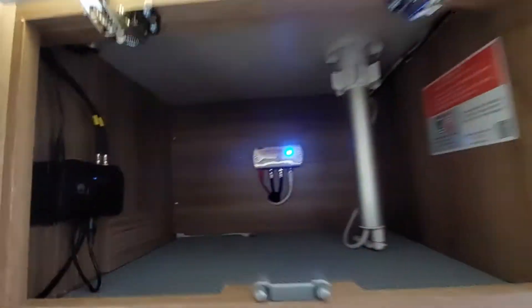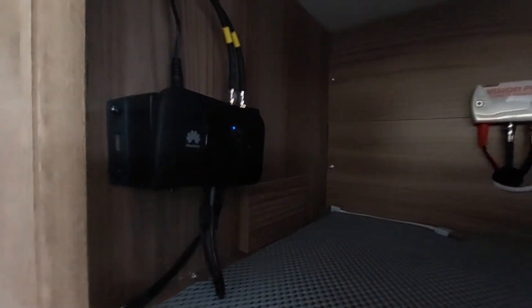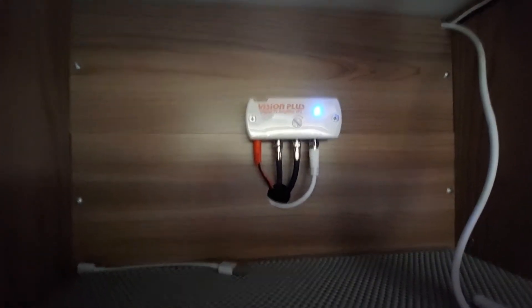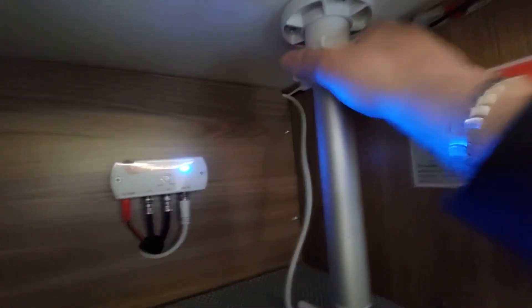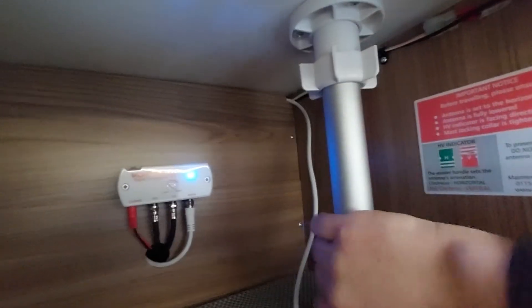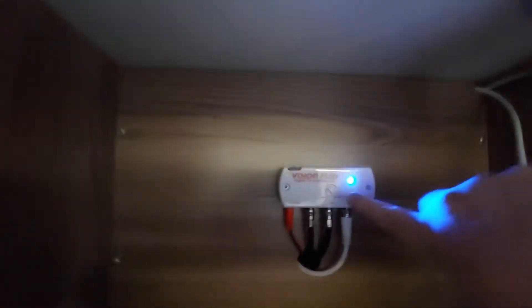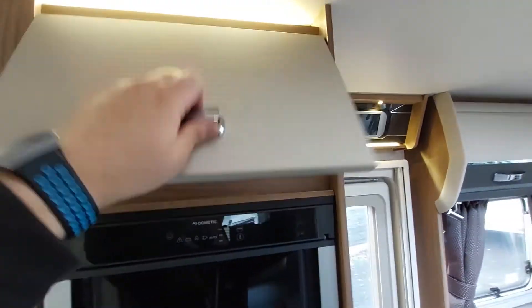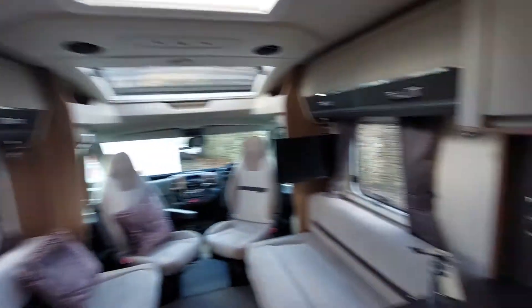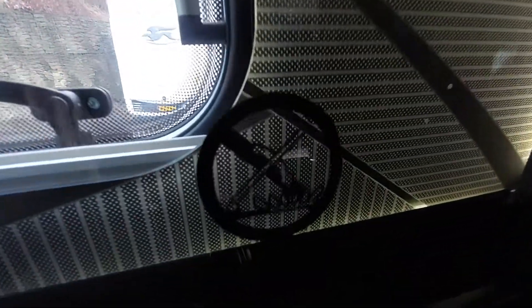Above here we've got your Wi-Fi — this has got a Wi-Fi system. It's a Motorhome One Wi-Fi system, not standard but the customer has added it. You've got your status aerial, booster box, and the pole itself. To alter the height, just release it and then lift the pole up and down to give you a better signal. There's also a frequency signal there that you can turn around to give you a stronger or weaker signal depending on the site that you're at.